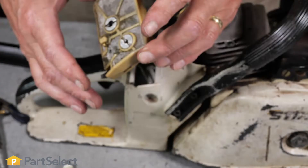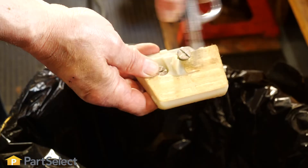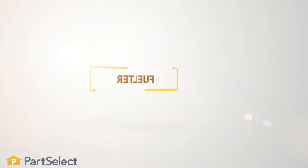The air filter. If your air filter is dirty or clogged, it can limit the amount of air that reaches your carburetor and prevent the engine from starting. Remove the air filter to either clean it or replace it. Also clean around the carburetor to prevent any future clogs.